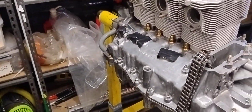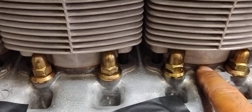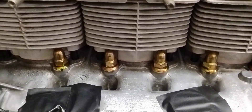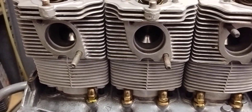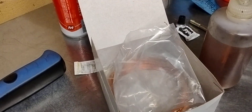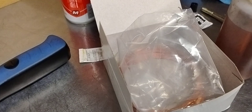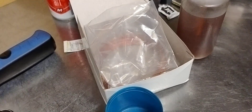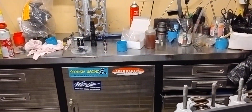All I've done is ascertained what cylinder base gasket shims I need, and these actually need a one millimeter shim. When you buy the barrels from Mahle, they come in all different height groups, so everything's different. Luckily I was able to order a whole bunch of one millimeter thick base gaskets from EBS in the United States. We don't seem to have a supply for them here in Australia — there are a couple of custom gasket cutters but I haven't had the greatest success, so you're better off just buying the ones that are ready to go.